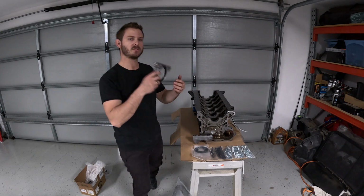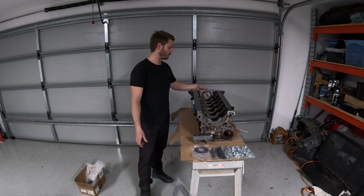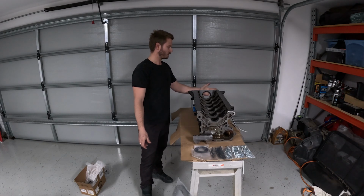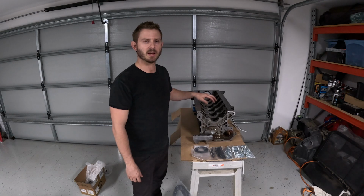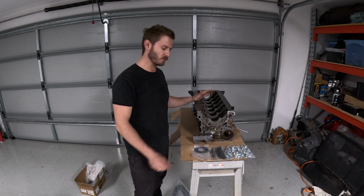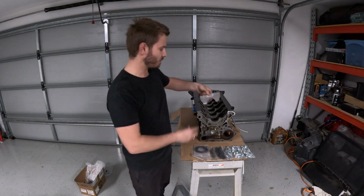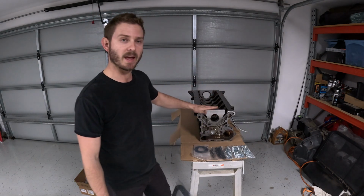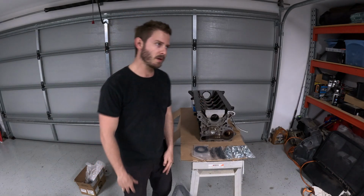with the rear main seal and the oil pump. And they sit it all together and they mill the tiniest amount, however much, of a thousandth of an inch off the top, just to make sure it's a level surface for their billet main caps. So these will go on and they will replace the factory girdle. You might remember